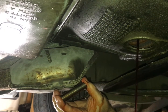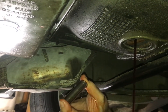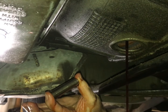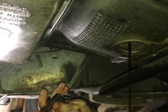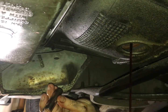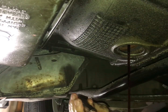We'll let the converter drain for a little bit — this will save us having to put five quarts of clean fluid in with the dirty fluid. I think 2000 and 2001 Mustang GTs have the drain plug on the converter. If you have a 2002 and later with the automatic transmission, I don't think you have that. I'm thinking at least another four or five quarts will come out. You can see how brown this stuff is — this is a smart thing to do just because it's probably never been changed.